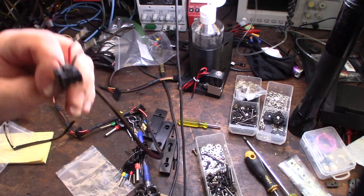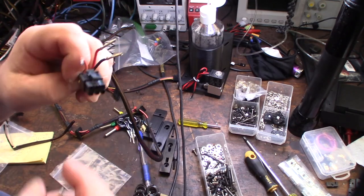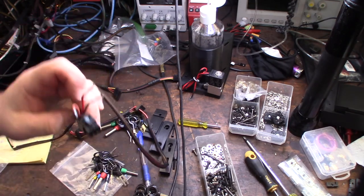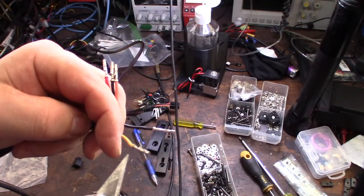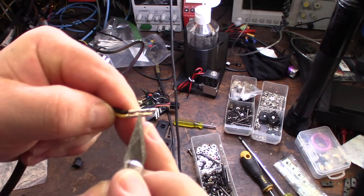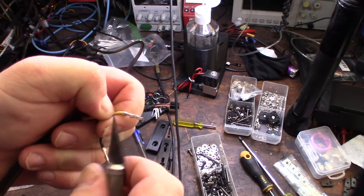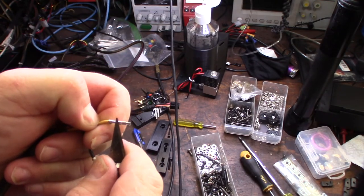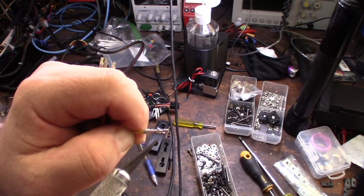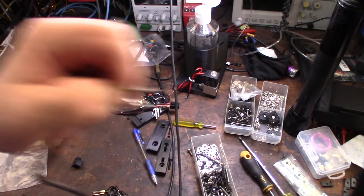This is a very difficult connector to remove the pins out of. I'm going to keep going and re-pin it, then I'll show you how to bring the pins back so you can reuse it. That little tab right here — I'm going to use my X-Acto knife to bring that little tab out again so I can reuse the connector. There's one on each side. That's the lock — those locks right there are what you're trying to unlock. When you push the pin down the side, it pushes that little lock in, and that's what allows you to pull it back out.